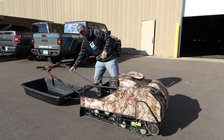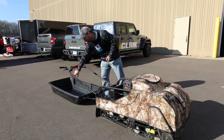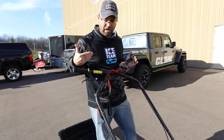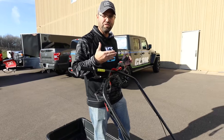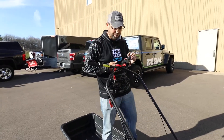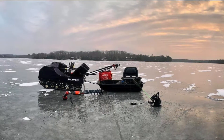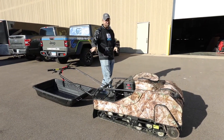It's super simple. This model is the B13 MER — we ran the R models, which stands for reverse. There's a reverse toggle back here. It's in forward mode and all I do is flick this lever backwards and now I can operate it in reverse. That's very convenient loading in and out of a truck, or maneuvering through tight quarters with a trailer. Flick that lever back forward and you're engaging forward motion. Tommy Hicks and the team run them right into the back of trailers and back them out when it's time to fish — that reverse is really convenient.